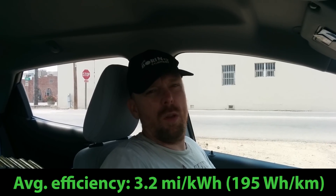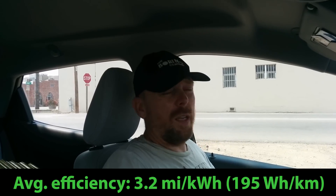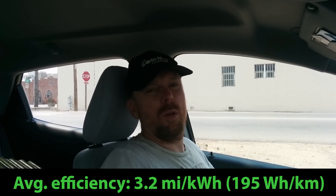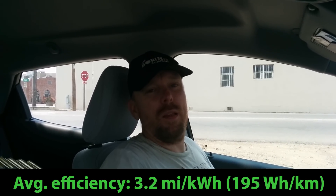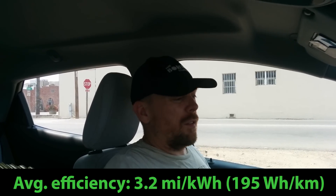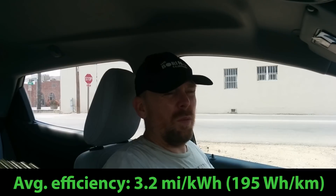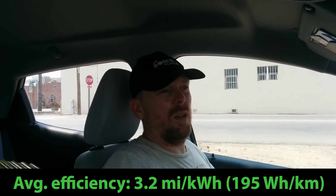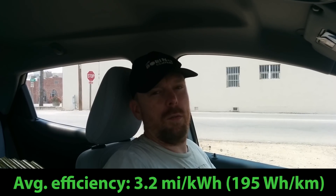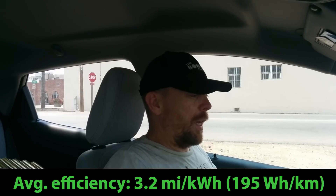Even this result is marginally lower than what I typically see, but then again I'm not necessarily driving the way I usually would and the tire pressure is lower. Overall, an average of 3.2 miles per kilowatt hour at 75 miles per hour or 120 kilometers per hour — that's what I would set as a baseline. Without air conditioning, 3.3 miles per kilowatt hour. Anything beyond that is really just real world testing. I might do another run at some point doing 65 miles per hour. One of the things we still have to do with the Bolt EV is map out its efficiency over a span of different speeds.